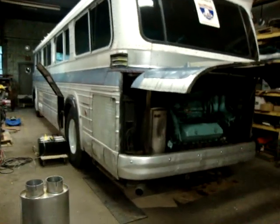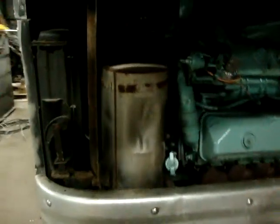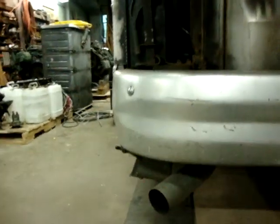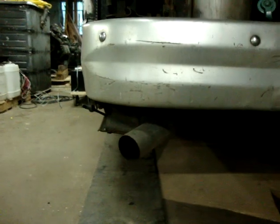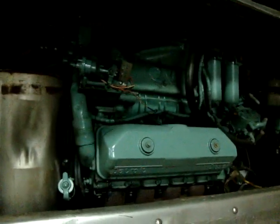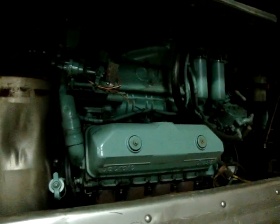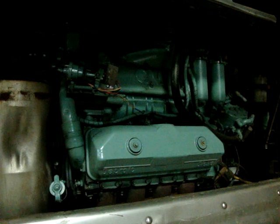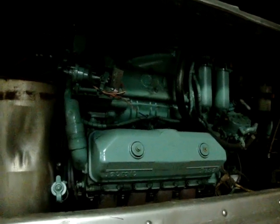It really goes over the road beautifully. But what we have here is the original muffler, and the only problem with it is, as you can see, it happens to have a 3.5 inch outlet — for an 8V71 with N65 injectors, advanced injector timing, and the RPMs bumped up to 2,450.